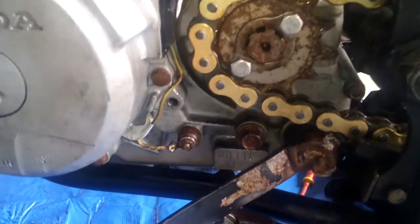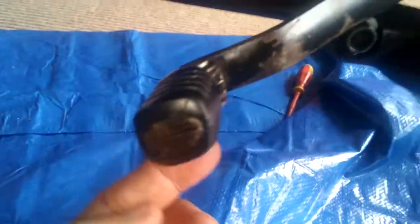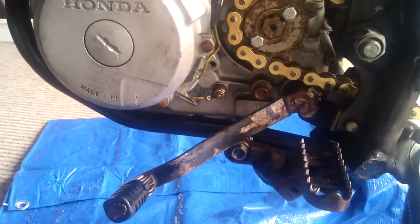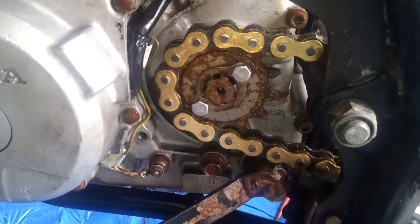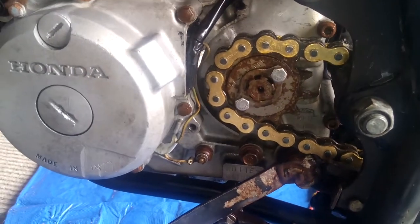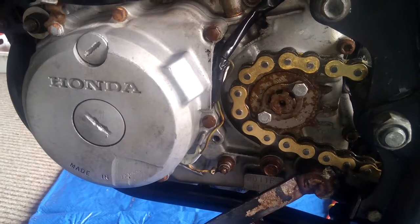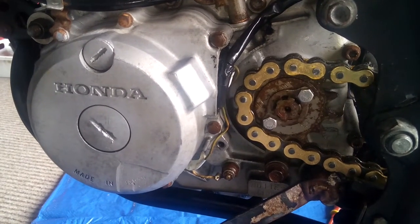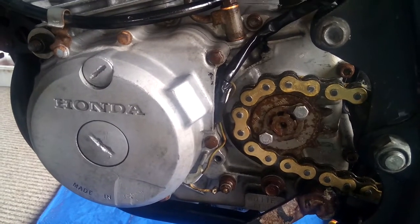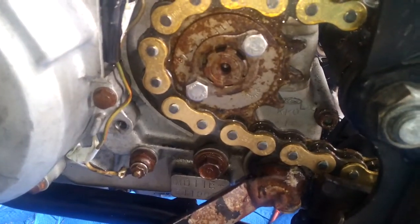I have fixed the job. My floppy gear lever is no longer floppy and sagging down — sagging down about there — which it was doing, and that's the giveaway. There's not much on the internet about it; there's a little bit on a Thumper forum with advice that you will have to split the crankcase to get the spring back on again, and that's pretty much the only choice people suggest. I'm really happy with my work. I spent all morning today, all yesterday afternoon — so that's one day — and another half a day before that.